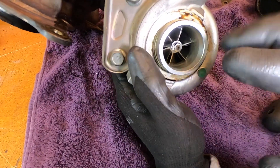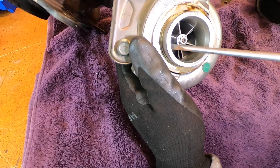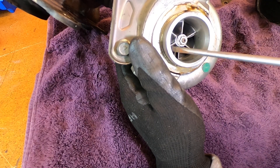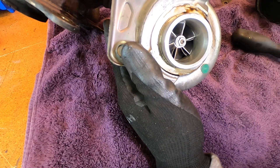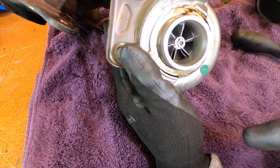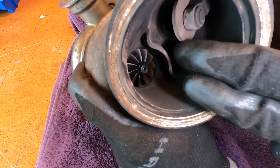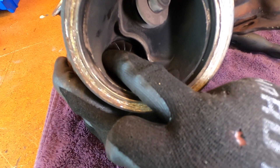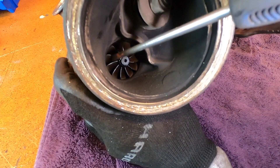Taking a closer look here at the inside of the turbo as you do a preliminary inspection — you take a look at the fins and you can see that the intake fins are actually okay. There's no abrasion or chips off of the fins themselves. You want to take a look at the axial play to make sure there's a little bit of axial play if you move it up and down. That's okay — that's normal for this age of the turbo. Take a look at the other side here, kind of the same thing. You can see the wastegate here — this is all going to get replaced anyway.